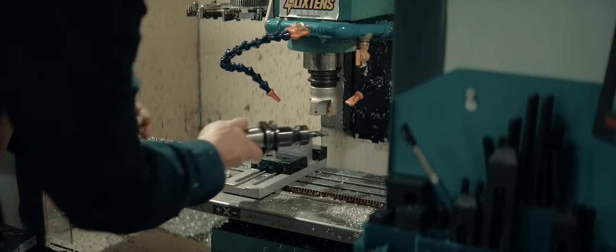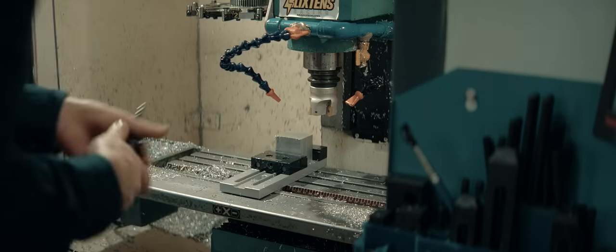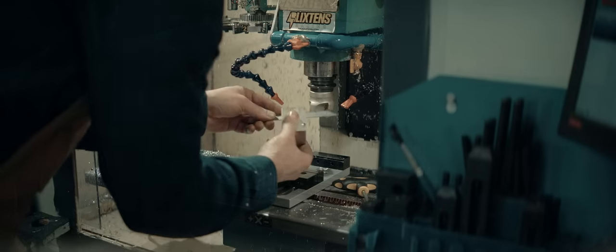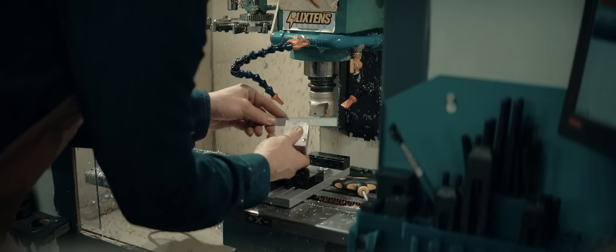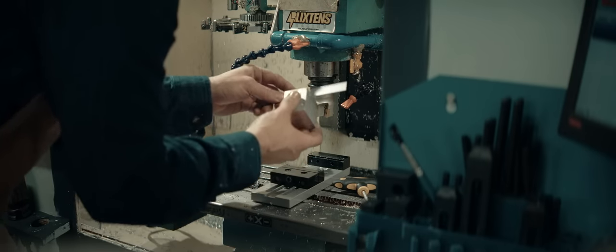The reason I'm usually using a small end mill for facing is because the machine isn't perfectly trammed and this averages out the scoops. Seems to be better than I remembered. It's not noticeable by eye at least.